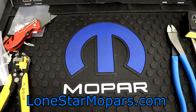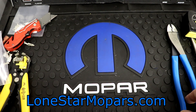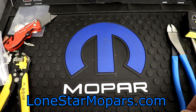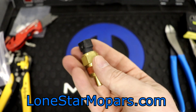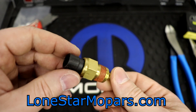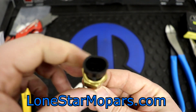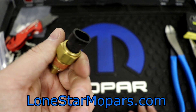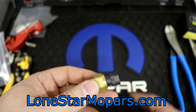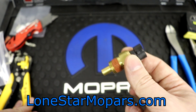If you are one of the many people moving your classic Mopar to EFI, you know one of the first things is step one — install the oxygen sensor — or step one, install the coolant temperature sensor. A coolant temperature sensor would be something just like this I've got in my hand. This is Holley part number 534-10, it's roughly 33 bucks, you can get these for half that price from pretty much anyone else. But you gotta have the coolant temperature sensor — it's a vital component for the EFI. So whether it's FiTech, Holley, Edelbrock, Fast, whatever route you go, this is gonna be one of the first things you have to do.